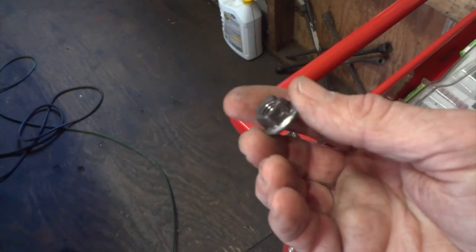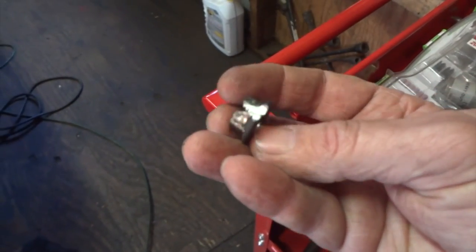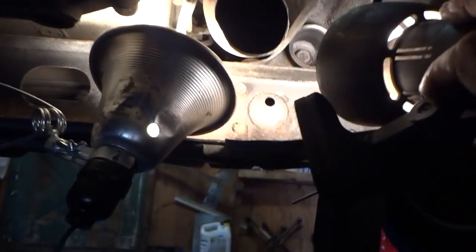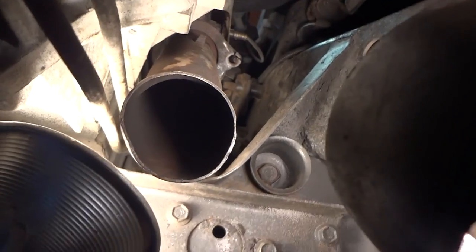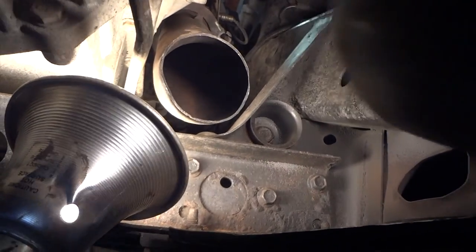These aren't very big bolts, but when they get welded on there with the heat after years and years of use, they get really hard to take off, and these have the flared washer on the bottom — it's all in one piece. The main thing was I didn't want to have to take the manifold off just to get these three bolts off that hold this pipe on. I have lots of room here because the converter is actually gone. If you're going to do this and need to replace your converter, I just cut the pipe off and threw it away to get it out of the way. Then you can get in here and do some work.